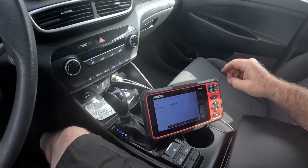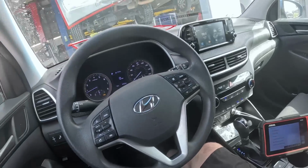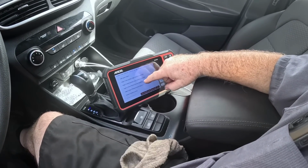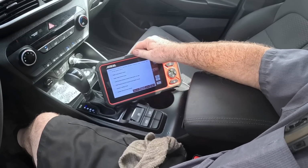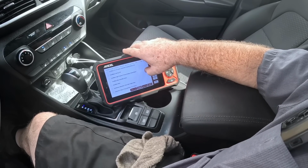All right, we're gonna get some misfire data up. I wanted to show you first, it is charging good. The battery tests good. So I'm thinking that the Die Hard might have been put in there, and the codes weren't cleared since then. But I'm gonna bring up some misfire data, and hopefully it's in here. We'll take a look, and because it wasn't in special functions or actuation tests or any of that, hopefully it's just in regular engine data.